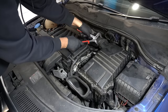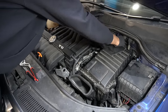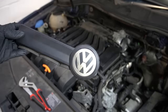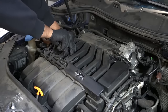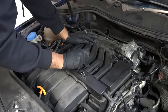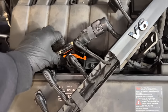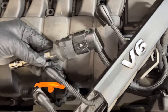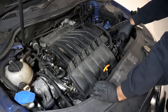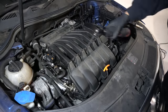Now it's time to get our hands dirty and we'll make a start with the rocker cover gasket first. The process is pretty straightforward — firstly you remove the airbox as you do with practically any engine bay related job. Then somehow I managed to snap the V6 plaque in half with basically no effort. This covers the coil pack harness, and unplugging the coil packs is next — they come out pretty easily with a tug from pliers, though I left number five attached to the harness because of how bad the clip was. You've then got various Torx screws on the lower part of the intake manifold.